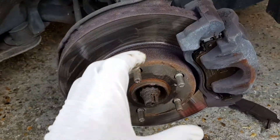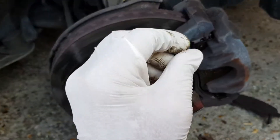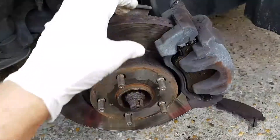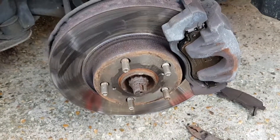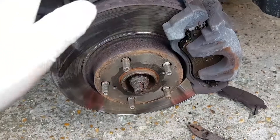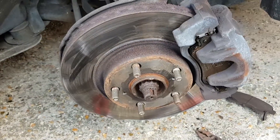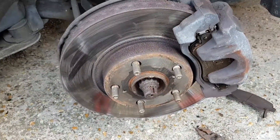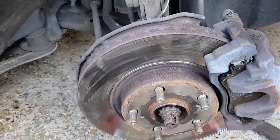Another little tip for you: every time you change brake pads or have to push the piston back, you might see when you're pushing it about three or four millimetres away from the actual disc — that can equate to about two or three pumps to the floor on the actual brake pedal. So whenever you change any brakes or touch the brakes, always make sure you pump the brake pedal up to where it should be and you've got a stiff pedal, especially where I am on the hill here.